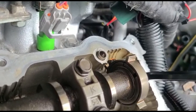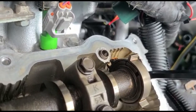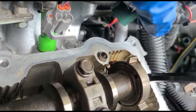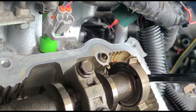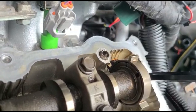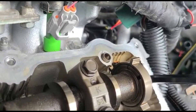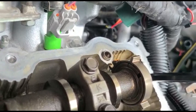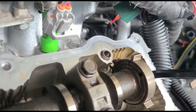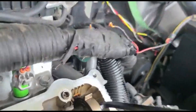If your cam trigger wheel is in the right location, make sure you have no issues with the cam wiring. Make sure it's plugged in all the way, because a faulty connection can cause this too. If that's not the case, you may have to suspect timing — that'll be a video for another day. This is just how to fix this department.